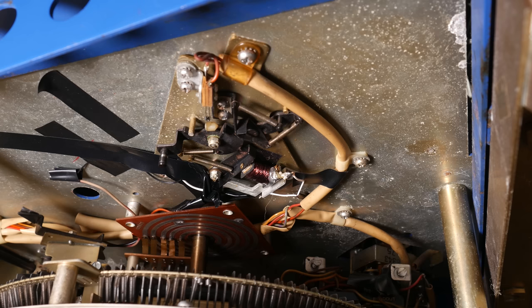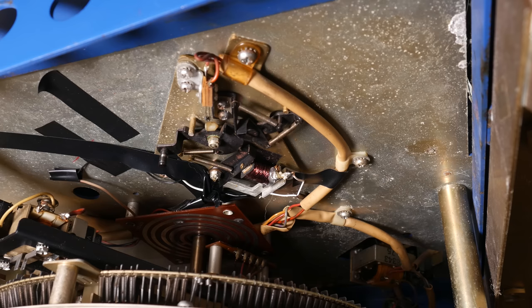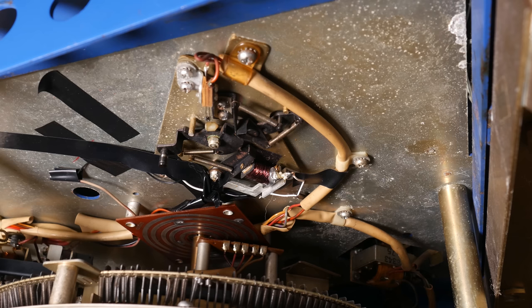So the reset magnet, the thing that the selection accumulator pulsed power to turn the jukebox on, was resetting this little mechanism, and every time you make a selection, it fires that magnet. So regardless of how many times the carousel has turned around, if it's made it past once, it's going to reset that mechanism, and it will take 2 complete rotations to shut off. It's actually a very clever and smart design feature, and undoubtedly saved many complaints.